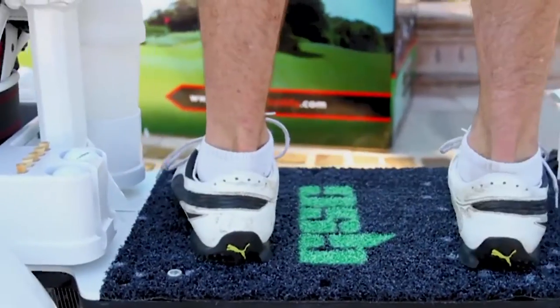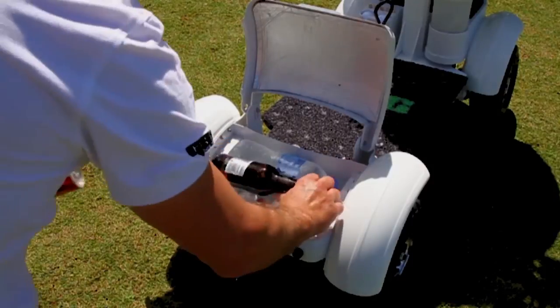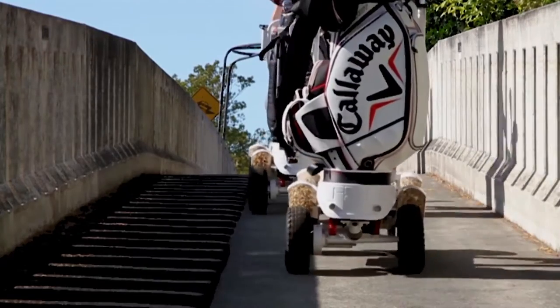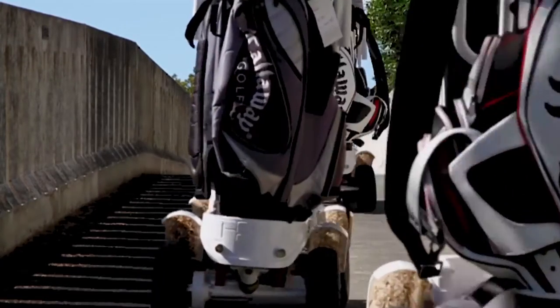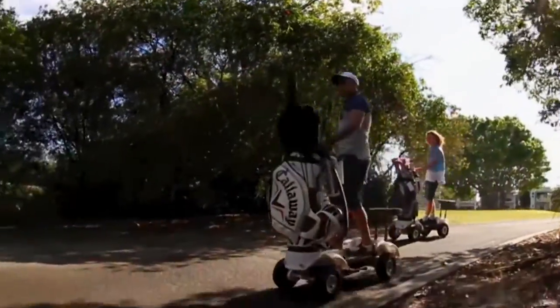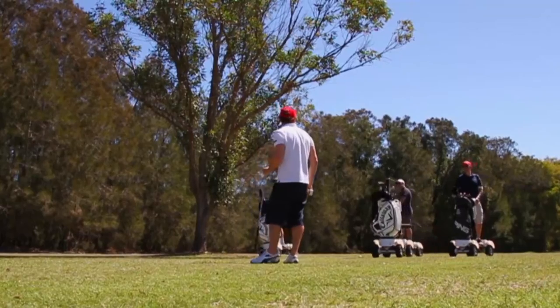We added things like ball holders. We added a grass surface so you could use your golf cleats on the board. You need an umbrella if it starts raining. You need an area to put beers and drinks with some ice. We added ABS brakes. We've got a dual drive system, so we have motors on the front and the back. We've added a lot of software to make it safer — going downhill, we automatically apply brakes so you can't accelerate out of control. We added a soft acceleration profile so you just don't gun it and end up on the grass.